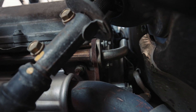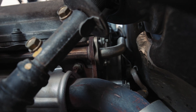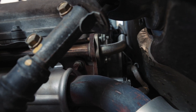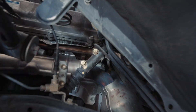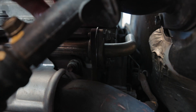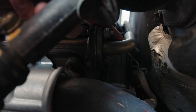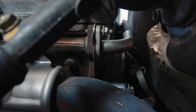I live in Arizona and this car is essentially rust free, so the bolts broke loose pretty easily. If that's not the case for you, just get some PB Blaster, shoot it on the bolts, let it sit overnight and it should break loose pretty easily. On this side there's a lot more room to push the piping back, and getting that block off plate in was pretty easy.